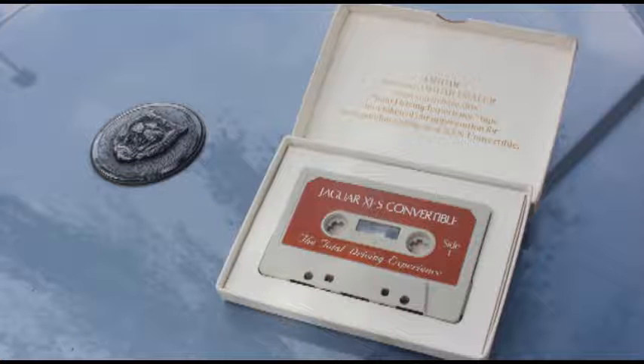The Jaguar radio features a unique anti-theft device. If the radio is removed, it will not operate unless a pre-assigned five-digit code is used. The code for your unit, as well as instructions for its use, are contained in the security package you received from your Jaguar dealer. The red security light at the upper left of the unit will flash whenever the ignition is off. If an attempt is made to operate or remove the unit, a warning tone will sound every five seconds for one hour or until the ignition is turned on, then off to stop the alarm.